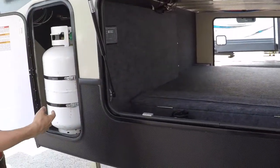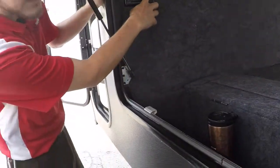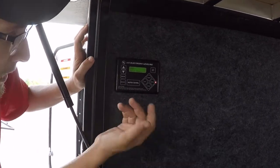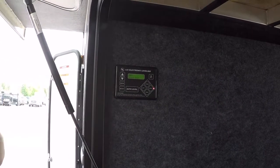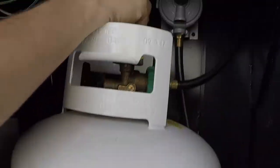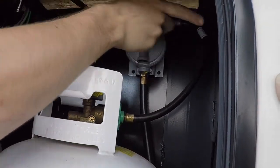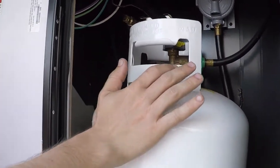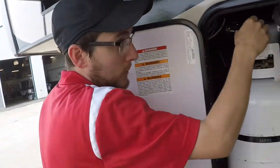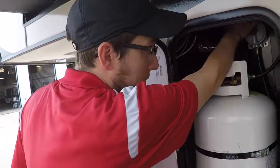Right here is your auto level system — it's the Ground Control. They give you full instructions on how to use it, but to turn it on, hit the on button over here. When it turns on it says 'ready, jacks down.' Basically the protocol is just hit auto level once you get where you're going and get it off the truck. You've got two propane tanks here — two 30-pounders, both full. Up here is your regulator for the tanks. You can see it's green — that means it's got gas. If it's red, it's empty. The valve: when it's facing this way it's feeding off this tank first. Once this tank empties out it will automatically switch internally to the other side. Do not leave it in the middle — it'll feed off both tanks till about halfway and then it will freeze up the regulator and you can blow out the O-rings. So one way or the other.